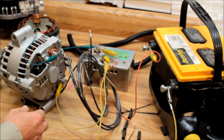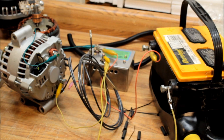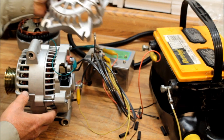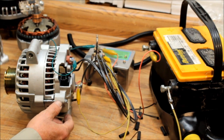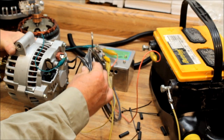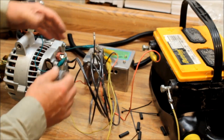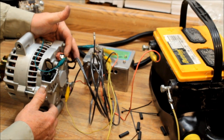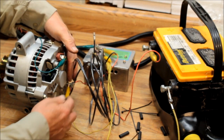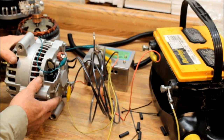This is a configuration for hooking up one of these dual rectifier alternators — if you're burning up rectifiers and don't have a solution, this is it. This alternator can come in different mounting styles; this one is set up for the Ford diesel with three mounting bolts and an eight-groove pulley. The five-four motor style will have a six-groove pulley, but the hookup is the same. Remember: three black wires go into the quick-to-fire regardless of orientation; hook up your old battery wire in the back of the alternator like normal; piggyback large wires from the alternator to the quick-to-fire and up to the battery; run the ground from the alternator to the negative post on the quick-to-fire then up to the battery. And you'll be all set — it's that simple.